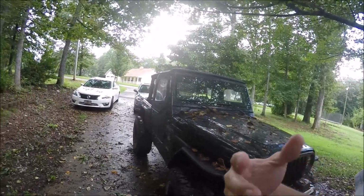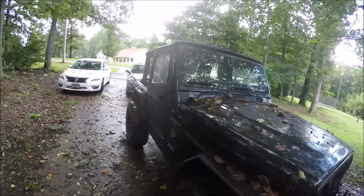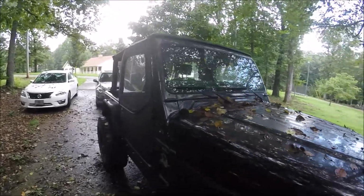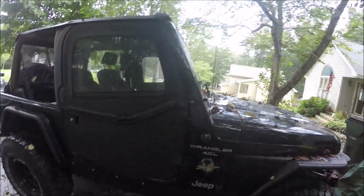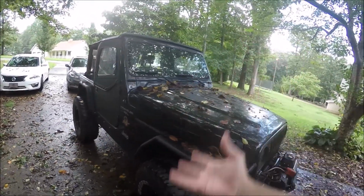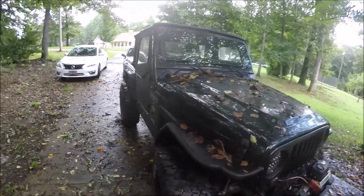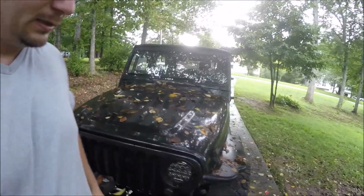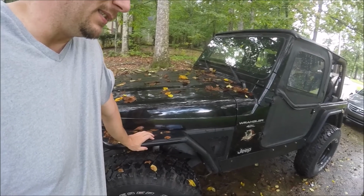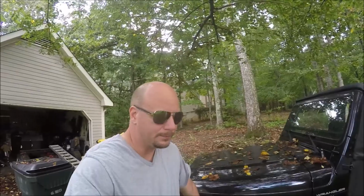Because it had gotten so late in the day, I didn't videotape the break-in process, but realistically I just got it up to 45 down to 10 and then 35 down to 5, just like the instructions said. You could really smell the brakes burning. I don't know what that does, but right after I got done with that and cooled them down, you don't smell them anymore. You can tell there's more braking power than what there was, so I'm pretty happy with them. I do wish that I had realized that 99 TJs have 2 different size rotors. It would have made things a lot easier.